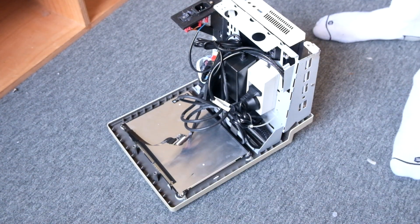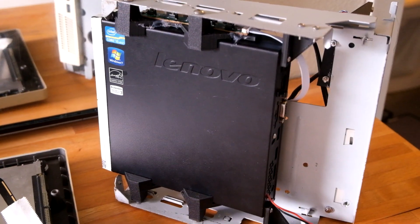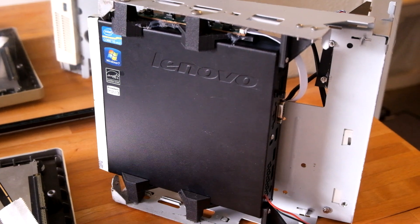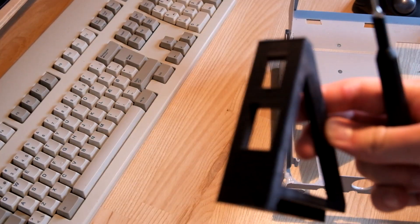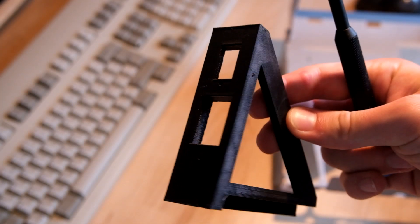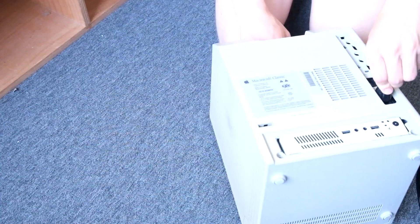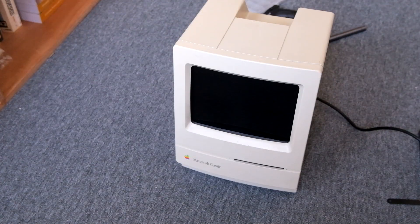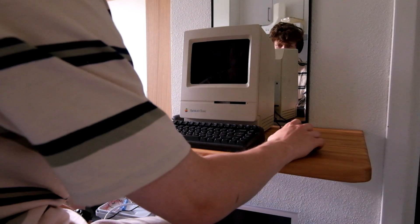Now for this whole thing to come together, I had to figure out a way to mount the electronics. I chose to mount it all on the chassis, so no cables would be attached to the back side, meaning opening and closing the case would be somewhat easy. I printed a right-angle bracket that would sit flush with the back of the case and hold all the extra IO. This was my first time trying to assemble it — while it was missing a couple of features, I just wanted to see if it would work, and it booted right up without a problem. It was very satisfying seeing it work and that the proof of concept was there.